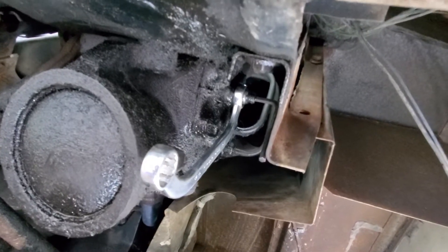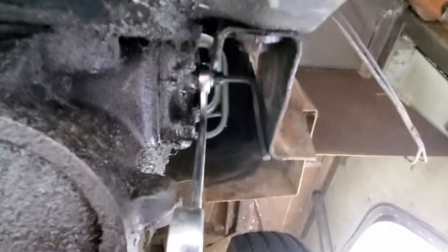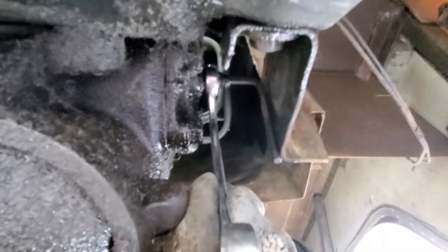Such as the P30 frame and UPS trucks and the like. What we're attempting to do is adjust this steering column up here — you can barely see it's got some movement as I spin it back and forth. We're trying to tighten that up. The first step is to take a 5/8 box wrench and place it on this set screw on the driver's side of the steering box.